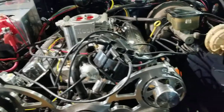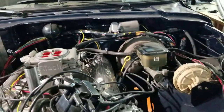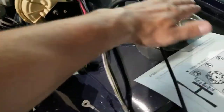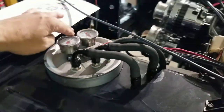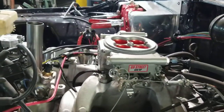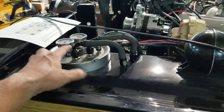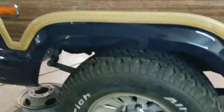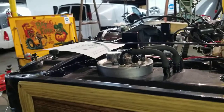What we're doing now is getting it running and driving, and then we'll start wrapping all of the wires. Right now you can see all our wires. We painted the engine bay and we put in a fuel command center — what that does is it brings up low pressure from the tank and then sends high pressure out to the FI Tech throttle body. We placed it here because when the engine bay gets really hot, the fuel is actually going through the fender well, keeping it cool.